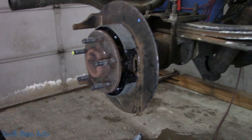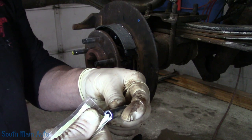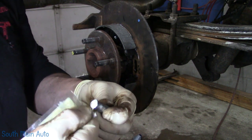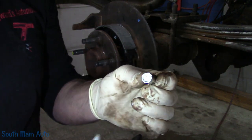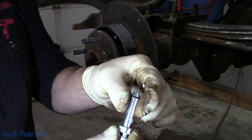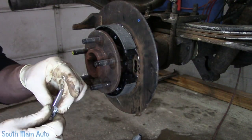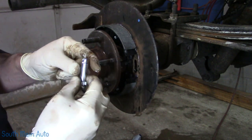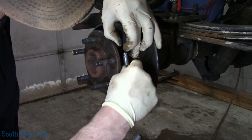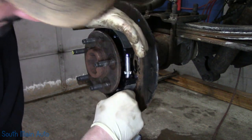Now we're going to take the bottom half of our adjuster — it comes with some white lithium grease. We're going to give her a little squirt in there. Then this piece I've already threaded together — stick her in there and just kind of turn around so it gets in the threads. Which direction did this face? It was facing down — remember, the screw portion was at the bottom. So we're going to stick that on there, get her lined up, spread apart the shoes just enough to get her in. There she is.